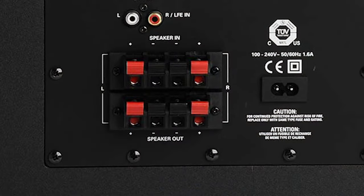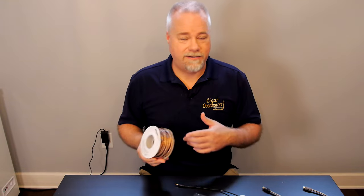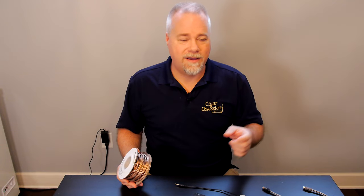What you'll see, like in this diagram here, is a set of speaker-in and speaker-out connections. You literally plug the same wires that you had going to your speakers into your sub. It goes in there first, takes out what it needs, amplifies that part of the signal, and then passes the rest right back through to your speakers. It doesn't do anything bad to the signal — there's nothing wrong with that. The reason I say it's the worst type of connection is because of the physical connections. Typically they are absolute junk spring-type terminals, or at best, cheap plastic binding post terminals using very substandard metals inside and very small gauge wires going to the board.